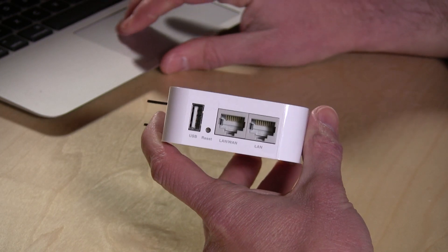It also works in repeater mode. If you're in your house and you have a weak spot, you can put this in between that weak spot and where your stronger signal is — maybe in the adjoining room — and it'll repeat the wireless signal it's receiving. There might be some limitations, like it may need to be on another wireless N network, but I found it works pretty decently as a wireless repeater. It also works as a wireless access point, so if you wanted to create a wireless network with an existing wired network, you can switch it into that mode and have it be another little wireless access point to connect to exclusively.